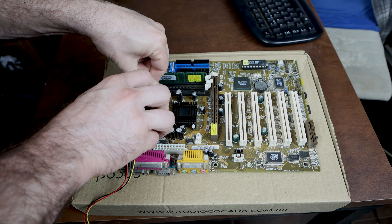For storage I'm using an 80 gigabyte hard drive. I could use an SD-to-IDE card reader but I have all these hard drives and they need to go somewhere — 80 gigabytes fits more than 100 Windows 98 games, more than I'll ever play. The motherboard has USB ports which makes transferring files easy. The Voodoo 5 fits snugly between the hard drive and the 3.5-inch floppy drive, though it blocks one drive bay due to its length. I'm using a somewhat modern PSU, and I rigged an extra fan right in front of the Voodoo's own fans to keep the rare card cool.